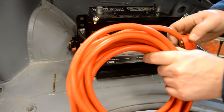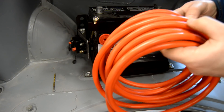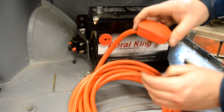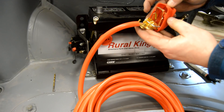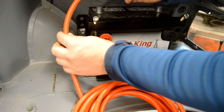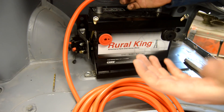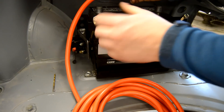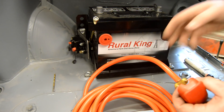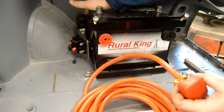Here's my battery cable — I bought it off eBay as well. It might be 20 feet — I bought quite a bit so I could have some extra. This is two gauge and it came with a quick-disconnect latch system, which is pretty nice. I'm going to run it right off of this post here down to the breaker. I'm going to get this first set of wires cut, and then the ground — I have the same kind of deal for the ground but it's black wire — the ground will come back, go through the trunk floor, and mount to the frame rail.